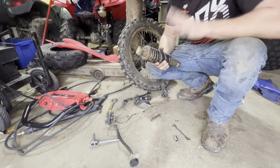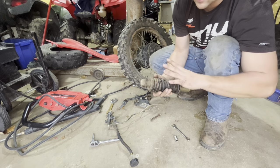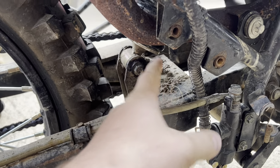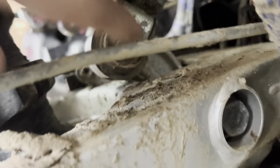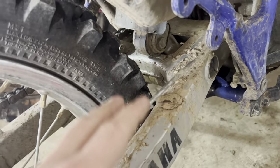Let's go ahead and take a look at all the parts we pulled off and go over what failed and a few lessons I've learned from working on this stuff for over 8,000 miles. First of all, the rear shock — this did really great, it actually works surprisingly well, although the back end is a little stiff. I have a feeling it has something to do with the mono shock. All mono shock means is that the shock directly attaches to the rear swing arm instead of going through a series of linkages like most dirt bikes have. Here I'll show you on this Yamaha TTR 230 — you can see the rear shock does not actually attach to the swing arm; it goes to this bracket here and through a series of cams.